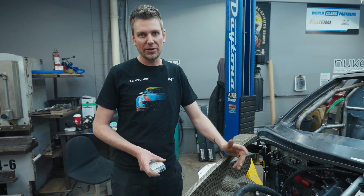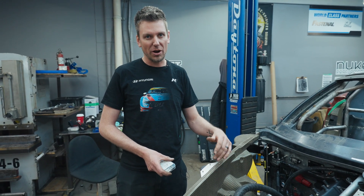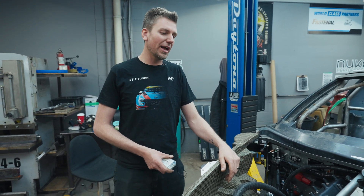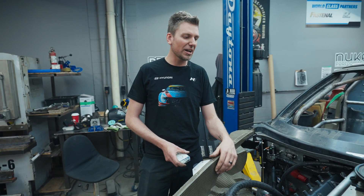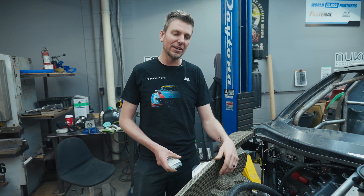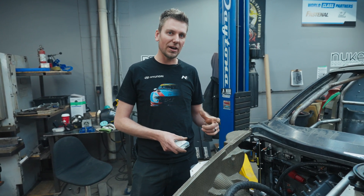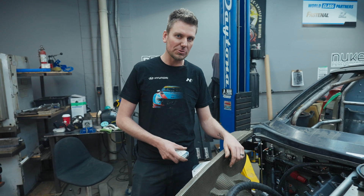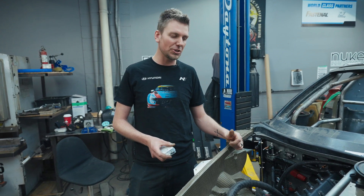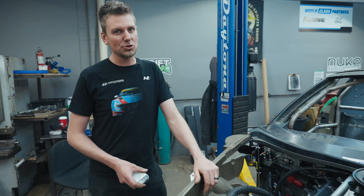Some rule books mandate that if you do move the battery, you need to have fuse protection. Because if that cable shorts out, a two gauge cable will carry thousands of amps before it actually starts to burn through — it'll just melt things. So fuse your battery. Good rule of thumb: a 300 amp fuse will cover pretty much any engine that's going to draw that kind of power. We run 200 amps, but on a hot restart day of a high compression V8 it does trip the 200, so I recommend going with a 300. Large subwoofer-style fuse enclosures with a 250 or 300 amp circuit breaker or fuse work great too.